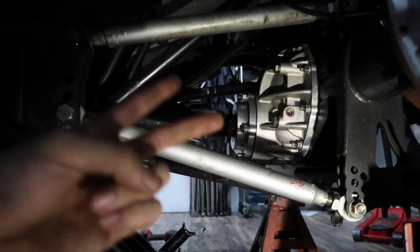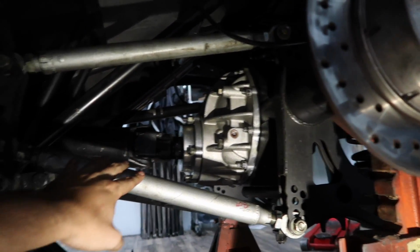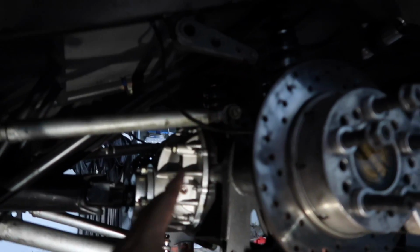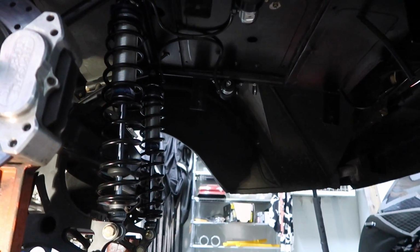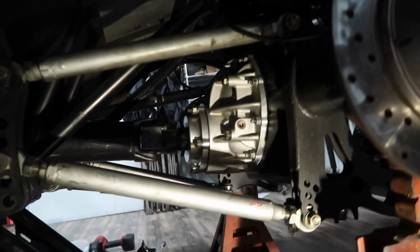We were testing down in Orlando. We were running Lights Out. We were running all these really good tracks, and we were able to get away with running a ton of bite, which is a ton of anti-squat, which is making this car separate real hard. We tighten up the shocks, which as you guys can see back here, you can see how nice and big and extended they are. That's how they are going down track, and the tighter you make them, it makes it harder for this thing to separate.